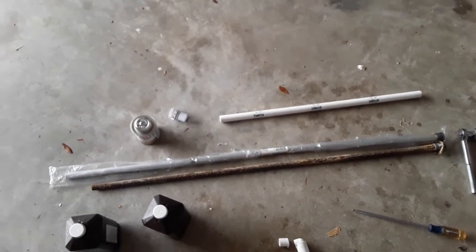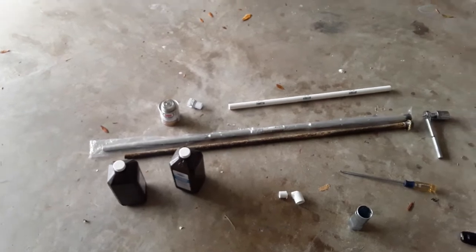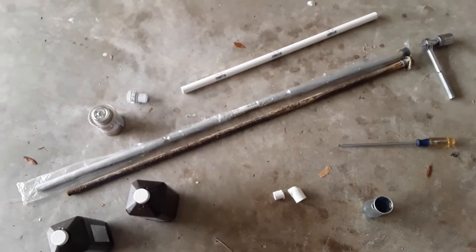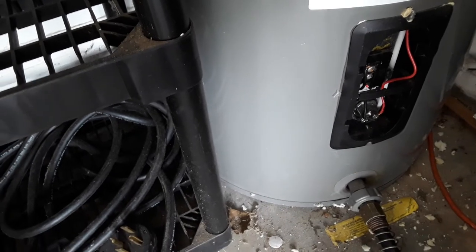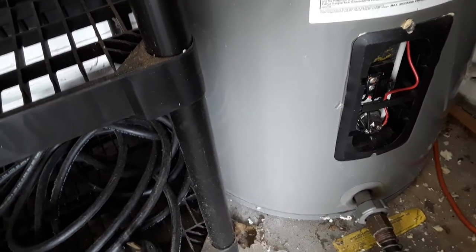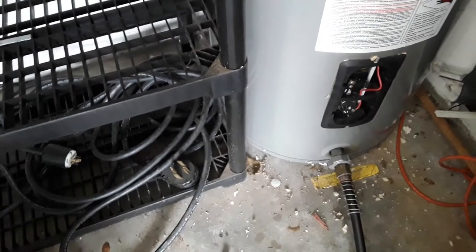It was $24.99. I bought two quarts of hydrogen peroxide to flush it out later. I also bought a PVC pipe with a hose bib connector and a right angle — I cut the right angle off so I could fit it in the bottom opening where the heating element is. I'm going to put the pipe in there at a right angle with a hose connected to it and flush out the bottom, because you can't always get the calcium and material off the bottom. I've seen this technique on YouTube.